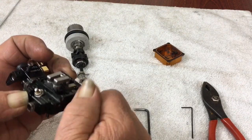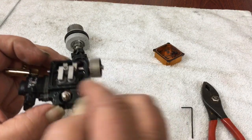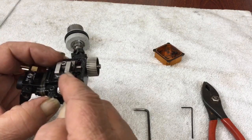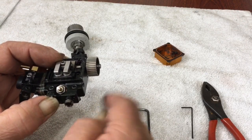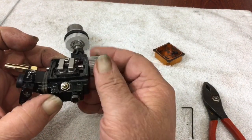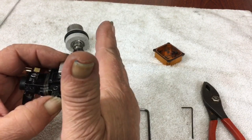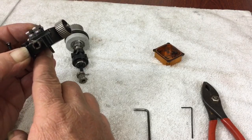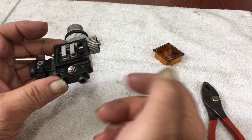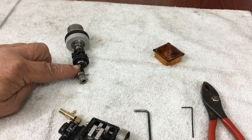I want to see if it's any different, if it corrected a lot of the things — even though it ain't gonna have a lot of draw and the exhaust ain't gonna open up big like it was to let the charge out like a high-performance motor. But it may bring this down to where the runnability problems might be gone now, because I do have a full compression stroke with torque and I've got sealed valves. I've got less oil blowing out anywhere because now it's not blowing the charge back.